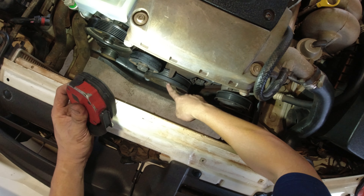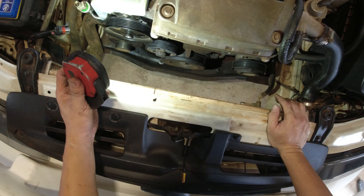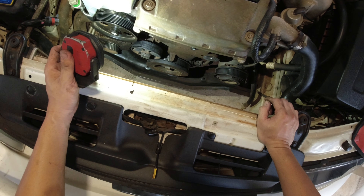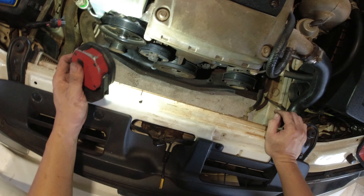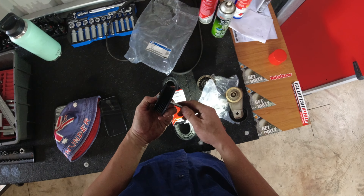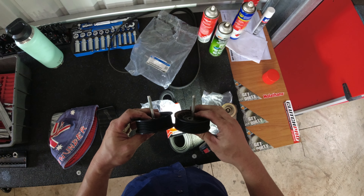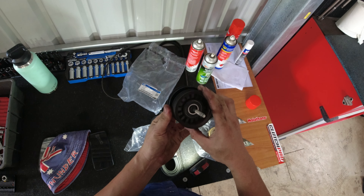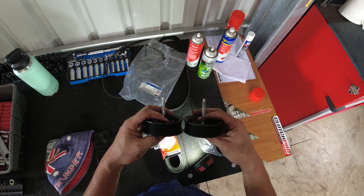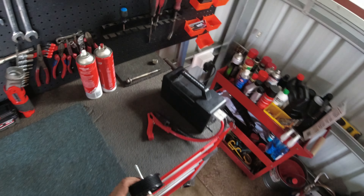If you want to replace the water pump it's easy — there are only a couple of bolts and you can replace it. But this water pump is still okay, and the aircon's okay too. I always spin everything when I remove the belt to see if anything is hard to spin — that would mean it's not good. See, they all spin fine. That one is the pulley — it's a hard one by design. Sometimes the harmonic balancer is also broken — it has rubber in it, so sometimes it spins but the inner stays. Hopefully if I replace that one in the future I'll put up a video.